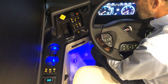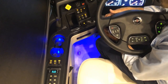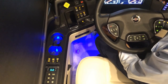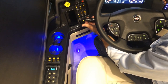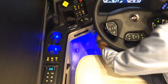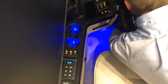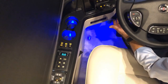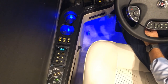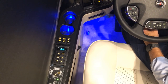The emergency flashers are here — pull that chrome lever out and the emergency flashers come on. To turn them off, activate the turn signal in either direction. On the left-hand side of the column there's a small button switch about 10 inches off the floor — pressing that resets the entrance code on the Trimark door handle. Refer to your owner's manual for more instructions.